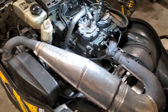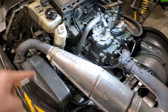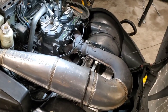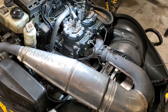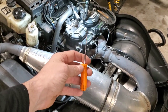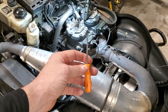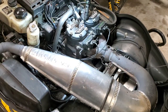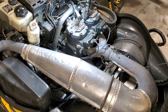To get down to the recoil, I basically have to take off the exhaust up here and then get down to the recoil bolts. You can see I'm actually missing a spring there I'll have to replace. There's one spring over here, three over here, and then a spring in the middle. That'll get us down to the recoil level. To take off the exhaust springs, I like to use a tool like this — a little pick. You can get sets of four all over the place; I got mine at Harbor Freight. It's real easy to grab onto that exhaust spring and pull back.